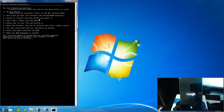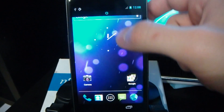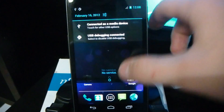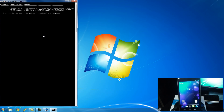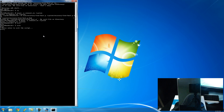Make sure that you leave it connected and that USB debugging is still enabled. So we're booted up — just make sure that USB debugging is enabled. Drag down — it says USB debugging is connected, so we're good. If it's not, make sure you go into developer options and enable it. Back on the program, we can go ahead and click any key to continue. And now it's going to make Clockwork Mod permanent. Click any key to continue and it's going to run the script that will rename this file so that Clockwork Mod is permanent. So once it's complete, just hit enter.